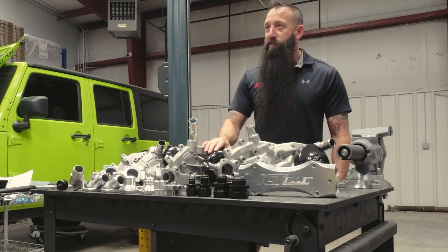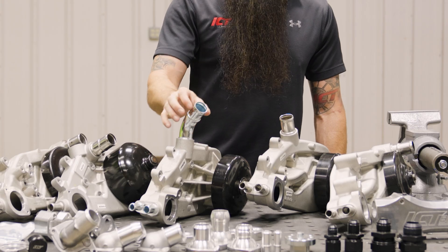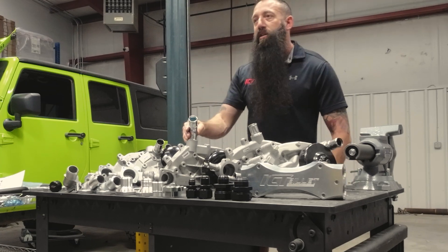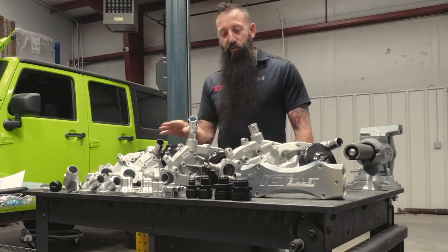This one here is the truck pump for Gen 3, so these are going to be your early LS engines. An easy way to tell is the neck outlet — it has this really goofy looking outlet. You can make it work on most things, but ideally you're going to run a forward-facing neck so the hoses look a lot cleaner on your swap.